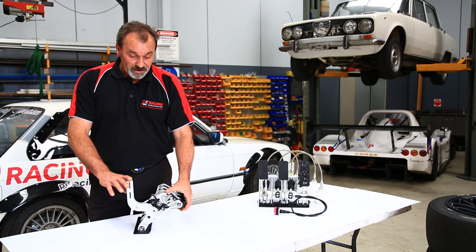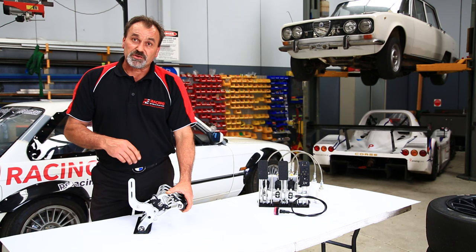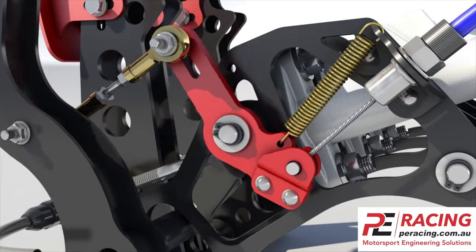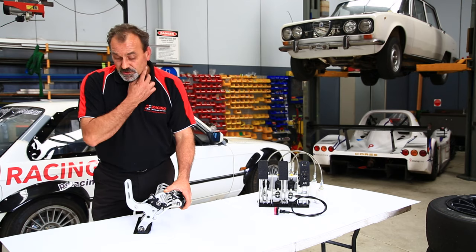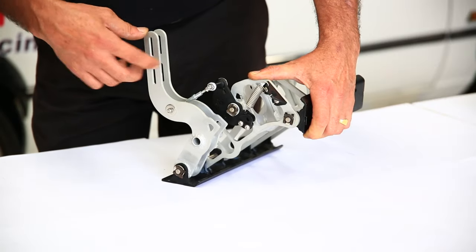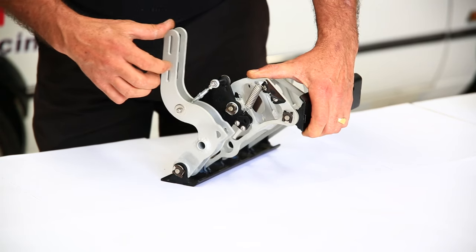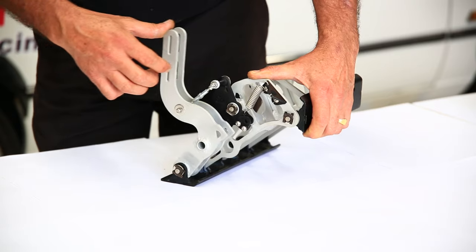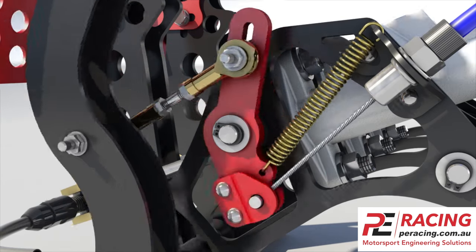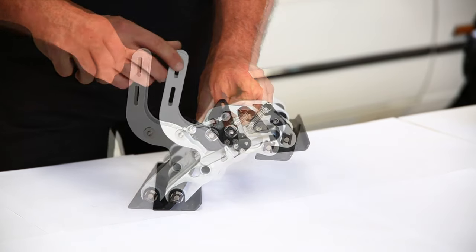One of the key features of the PE Racing pedal box is the tunable throttle system. As the stroke is separately tunable to the progression, the stroke length is simply clamped in a position in the slot on the linkage, and progression is separately tunable. This setup is currently showing the least stroke available with increasing progression. We can quickly go from one extreme to another for decreasing progression. We can also quickly adjust the slot of the linkage to increase the overall stroke, then tune the progression in again with the rod length.